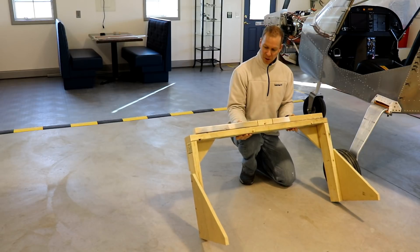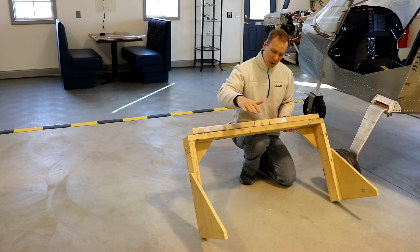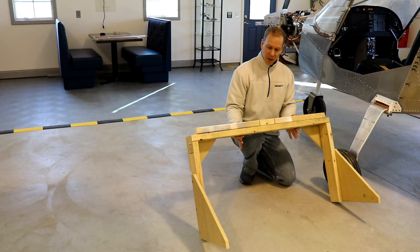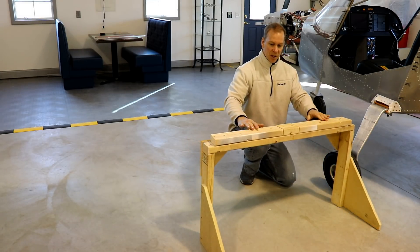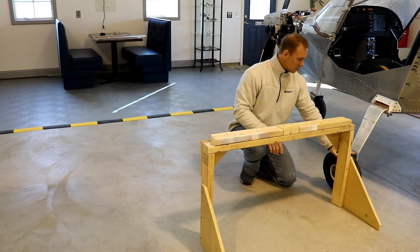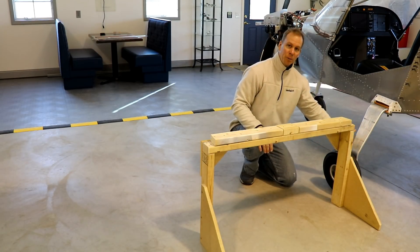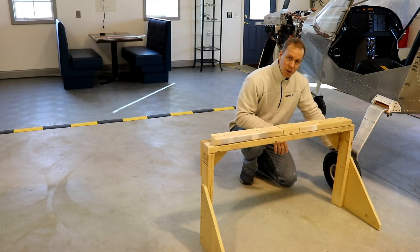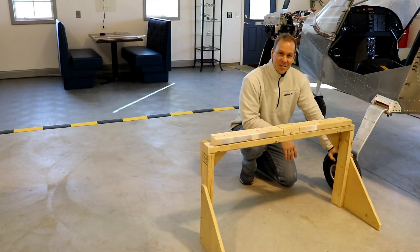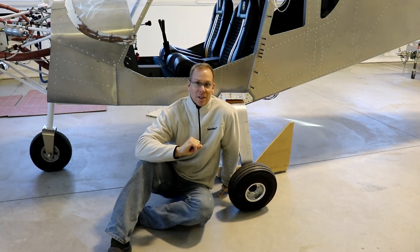The thinking with this design is that if this thing can rotate it'll create an arc, and the top of that arc will be the highest point. So if I put this under the fuselage until it's just touching the bottom, and then rotate it back like this, it'll lift up the fuselage just about an inch to an inch and a half. That gets the wheels or tires off the ground, I can take the wheels off, and then once I do that this gear will be about six or seven inches from the floor so I can remove the two nuts and drop the whole gear down. We'll see how that works — now is the test to see if my genius engineering works out.